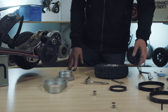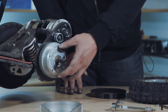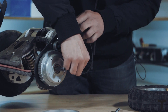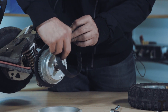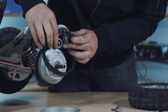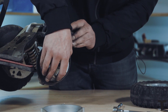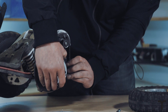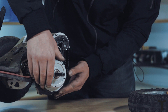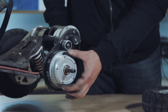Now we're getting to reassembling with the new belt. I'm going to put the slave pulley on first, then put the belt over the motor pulley. While holding it down over the motor pulley, I'm just going to wrap it around the belt tensioner and start to feed it onto the slave wheel. Then you start to wrap it around here and turn the slave wheel — just make sure it doesn't come off the motor pulley at the top — and it should slip on. So we've got the belt on.